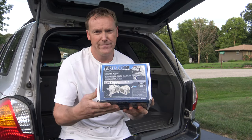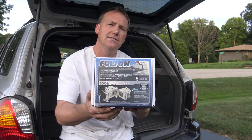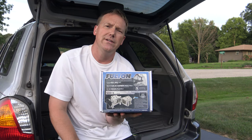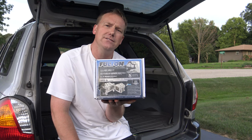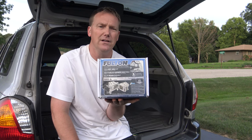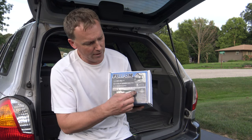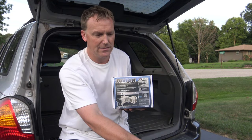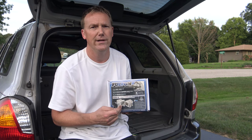This is what it looks like and I'm going to be installing it step by step so you guys can follow along. I'm going to give you a couple tips and tricks on how to install these a little faster and a little better. I've installed these before and they work great. You just want to make sure you order the proper kit — this is the 3x3, meaning the trailer tongue is 3 inches wide by 3 inches wide. Fulton makes several different kits, so just make sure you order the right kit for your trailer.